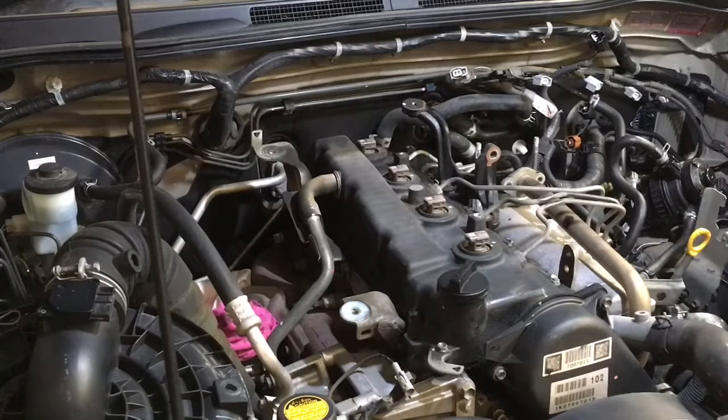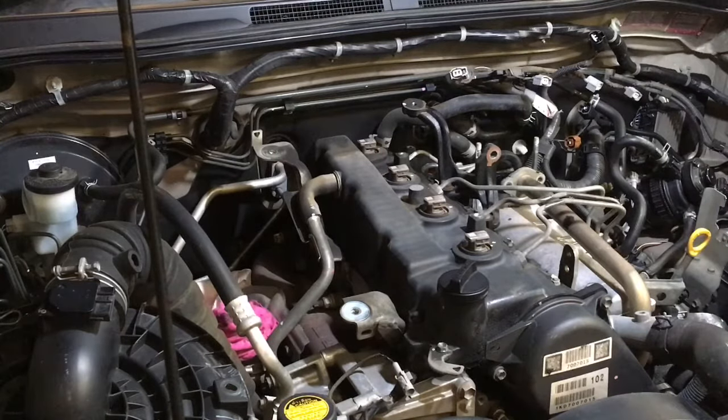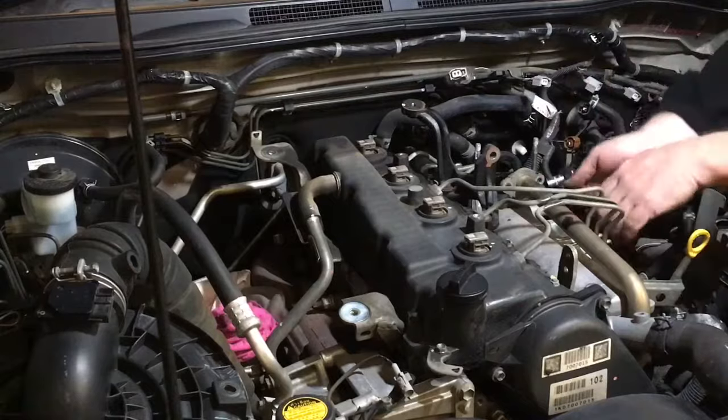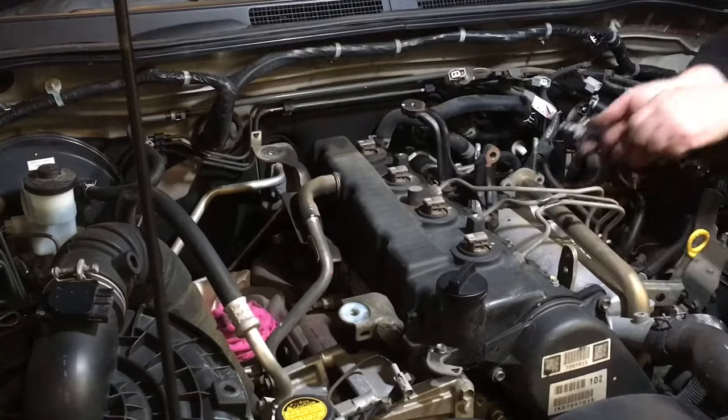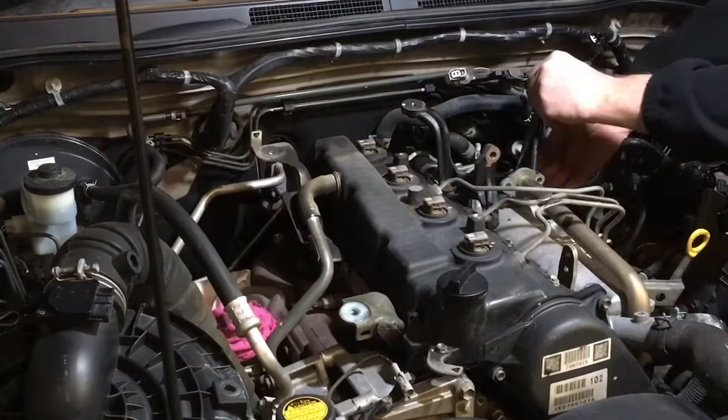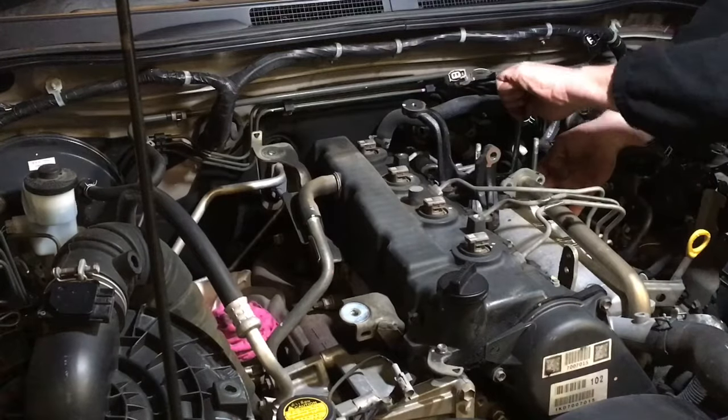Right, so basically we've got all our EGR and everything off out of the way, and almost all our clamps off the pipes. On the Euro 3, on number 4 fuel pipe, there's 2 12mm bolts. Okay, so a bit different on the other one, on the Euro 4. Can't get to it with that, so I'm gonna grab a 12mm ratchet spanner. On the Euro 4, there's 1 10mm clamp, which don't forget to put that on there. You do need it. All the clamps are there for a reason. Stick with it.